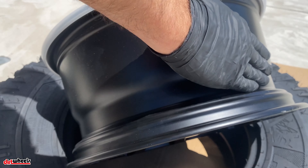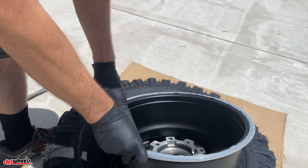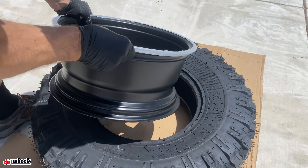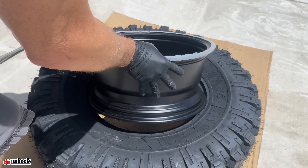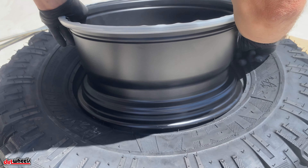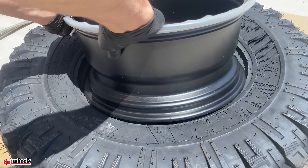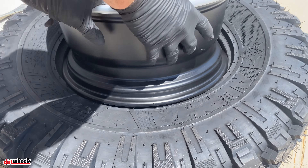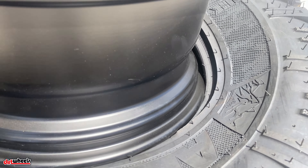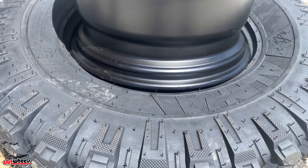This indentation is very important — this is the side you want to put on first, and you're going to use that on both sides of the tire. Kind of push your wheel into the tire and let the bead of the tire get into that groove. The more bead of the tire that's in the groove, the easier it'll be to spoon on the tire.